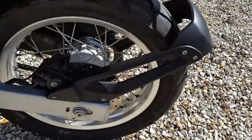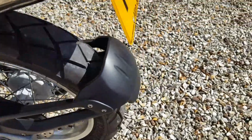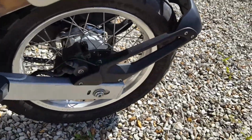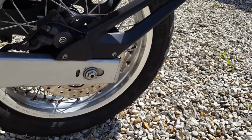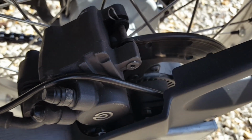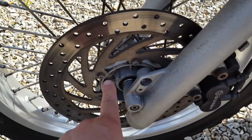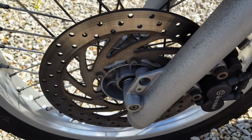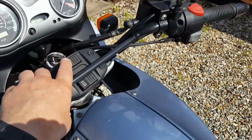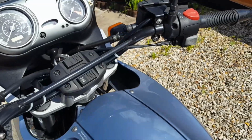So you know, your odometer. So yeah, the speed sensor's there, the reluctor ring's in there somewhere. Oh, I can't see it now. Yeah, typically, I'm sure. Oh, it is down there. It's right down in the middle, the reluctor ring. But on the front, there's space for the ring and a space for the pickup if your bike is equipped. So it doesn't have the ABS pump. Where the ABS on-off switch would normally be, we've just got a blank switch looking thing, but there's nothing under it.